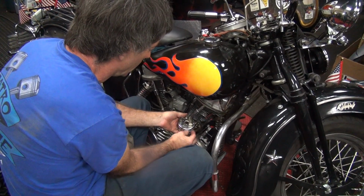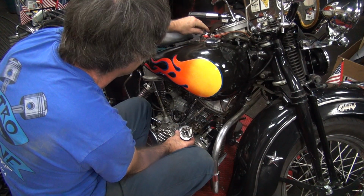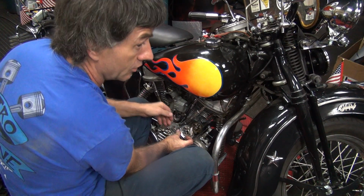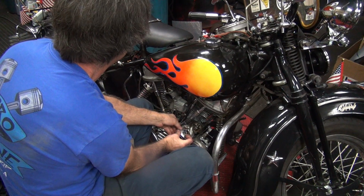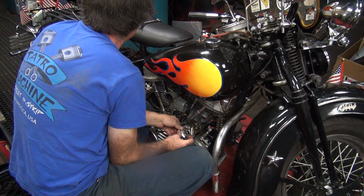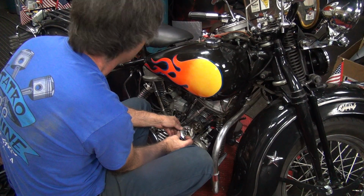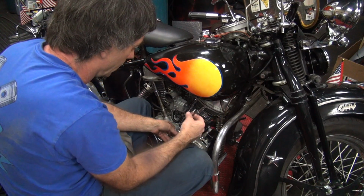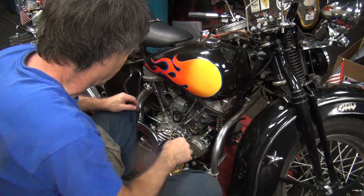Okay. Now everything's hooked up. Okay, we turn on ignition. Work the points right here. Sparking over there. See, the spark plug's right here, so there it goes. It's good spark. Bouncing sparks all over the place. I'm not sure it was shorting out before. Probably a plug wire. Okay. So we know everything works now. We've tested it. So we got one more opportunity to screw it all up by assembling it. I'm pretty good at doing that.